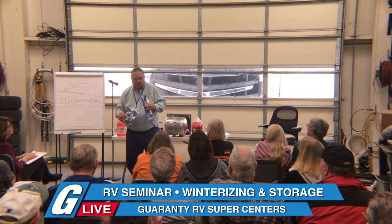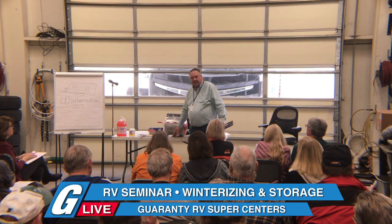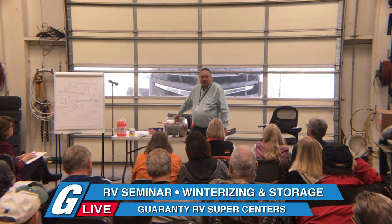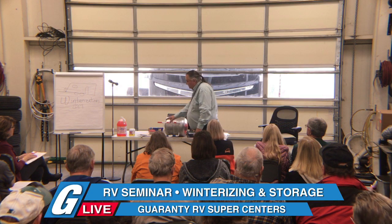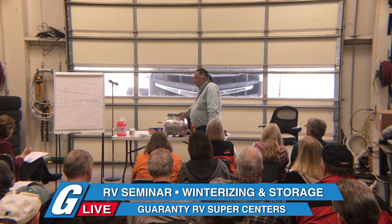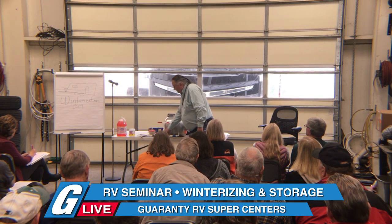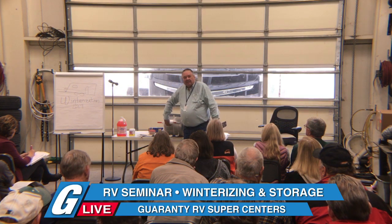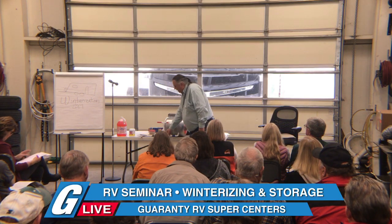These things really help. This is an aftermarket version of this bypass. This is what most of you have if you have a newer coach. In the last 10 years or so, most coaches have this bypass. Now, they may look different, and the theory is the cold water comes in at the bottom and it's heated and comes out at the top. So this valve is open, this valve is open, the bypass is closed. You can tell if it's open or closed because the handle is always in the direction of flow. So this is open, this is open, this is closed.